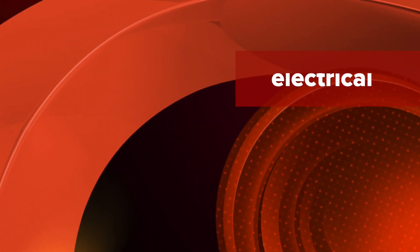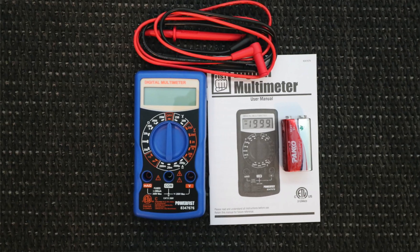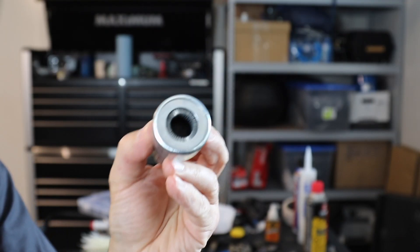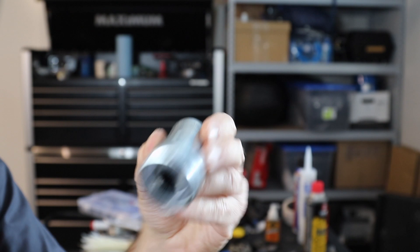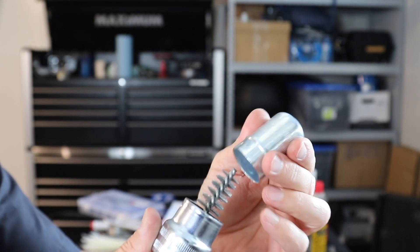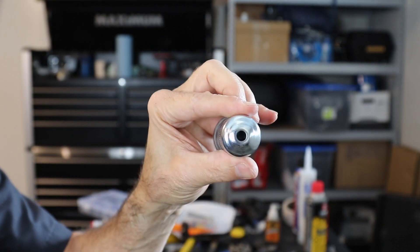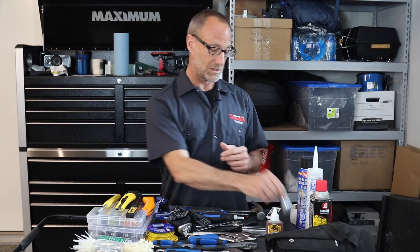Often RV challenges are electrical, so a crimper, stripper-cutter tool, a multimeter, and a terminal brush will handle most fixes. Battery terminals tend to corrode and then they don't conduct anymore — your battery won't charge — and because we tend to neglect and store these batteries for a long time, it's a serious problem. These are about four bucks, so it's a cheap instant fix to solve your problem.